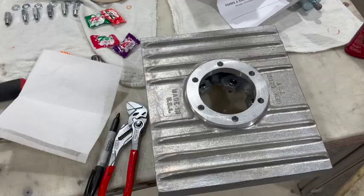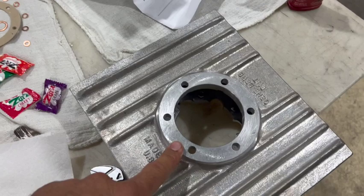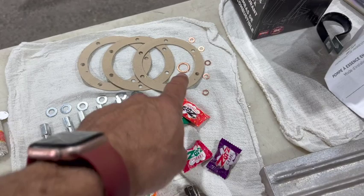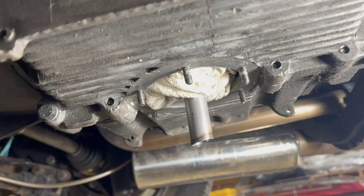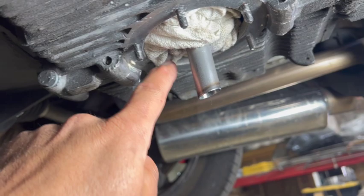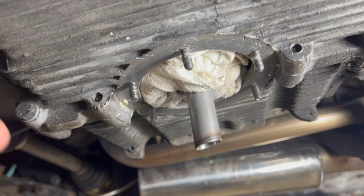Before we stick the two together, we're going to put one paper gasket here with some 12-11. 12-11 is our sealant. We're going to use one of these supplied gaskets at the base. I clean everything here with denatured alcohol. Now I put this rag inside to take out once the sump is actually in place — that mitigates oil dripping out while we're working on it. It gives us a longer window of time before any oil could potentially get in between the sump and the sealant.